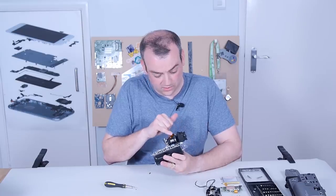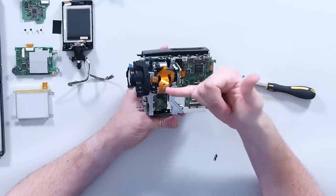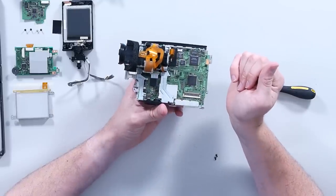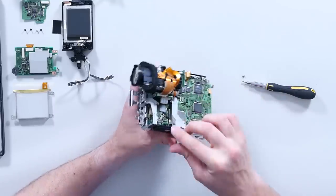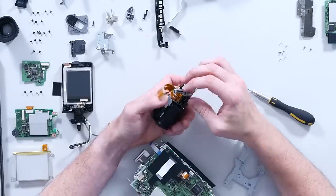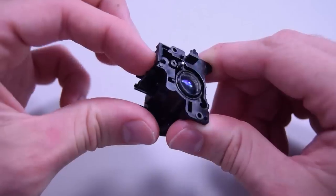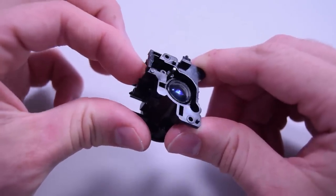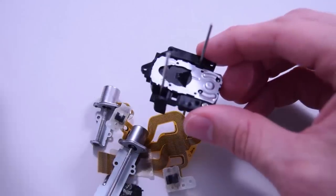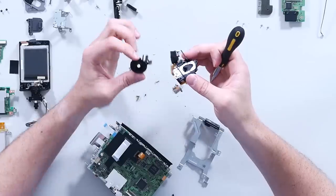There are all the connections onto the sensor array. In here you've got all the circuitry for autofocus control, the CCD sensor at the back, and control for actuating the zoom. This tiny little motor with a worm drive and a small slider is the focus mechanism. There's also another motorized iris, which I hadn't expected. And last of all, the zoom motor worked in a very similar way to the focus one, shifting forwards and back — they would have worked in tandem since moving the zoom also moves the focus.